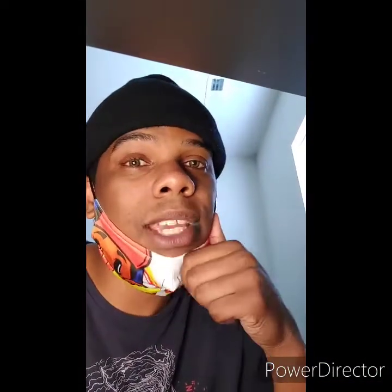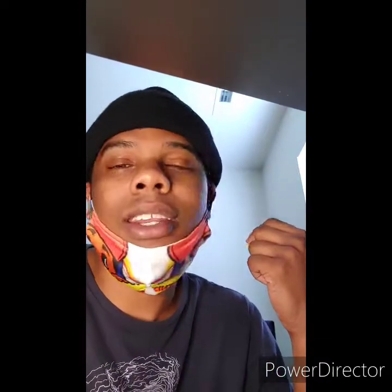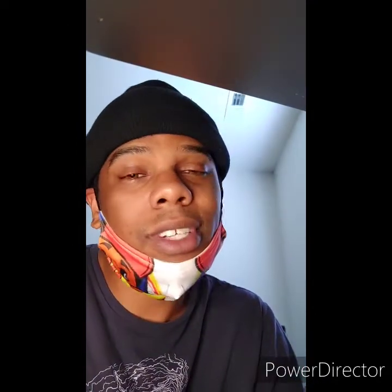What's going on everybody, it's Sean Mac at SMC Creations where I'm steady making clothing creations. I wanted to make a video really quick because I've been having an issue with my heat press — the digital timer cuts on but I can't adjust the heat, it doesn't count down, and when I close the clamshell the magnet won't keep it down. So I did a little research and got a hold of Heat Press Nation.